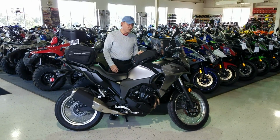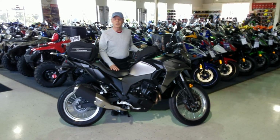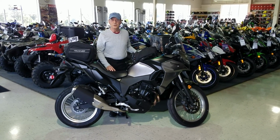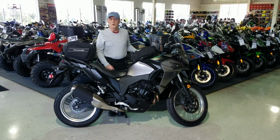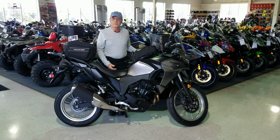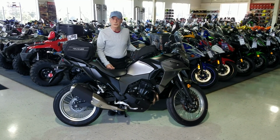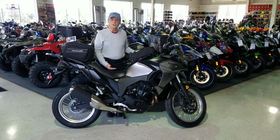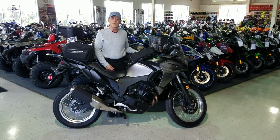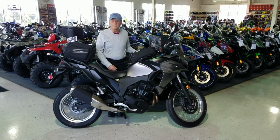A couple of things that I didn't talk about with this bike the last time, or at least one major thing, is it was funny, several years ago when I picked up my Ninja 300, I did a video review for the Kawasaki rep, and I told them one of the things I think would be really neat to have on this bike was a slipper clutch. Now for those of you that don't know, slipper clutches are used in racing, so when you're downshifting, it keeps you from locking up the rear end. Think of it like ABS braking for downshifting.